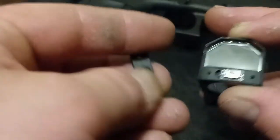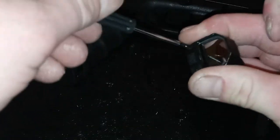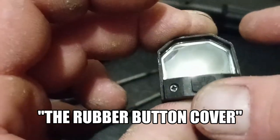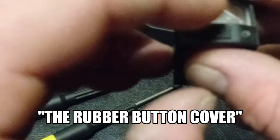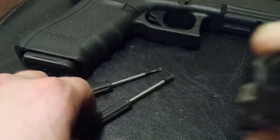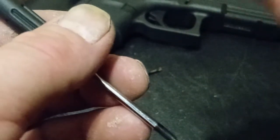I'm going to go ahead and reattach this plate and see if that fixes it. Now it's not working again. So I'm getting the impression that it's the button — it's not allowing me to turn it on and off. I left it on before I put the cover back on and it's still on, but now it's not adjusting the brightness. Basically, the button is not working, which means it's not going in far enough to do what it's supposed to do.